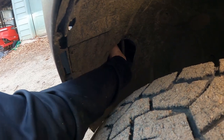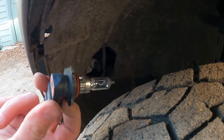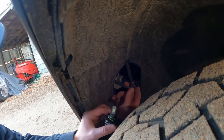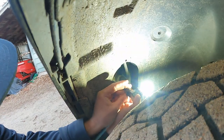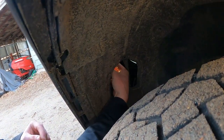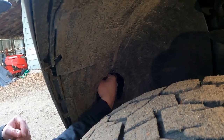Pulling that pin out gives us access — a nice hole. You just reach in and find that light. We're gonna unplug the pin from the wire. This light was fighting me coming out, but there we go. Now we're gonna take this plug and match up the back of the pin — there's a little hook — and then blind ourselves momentarily, find that hole, and stick the new LED in there.